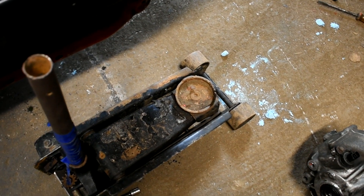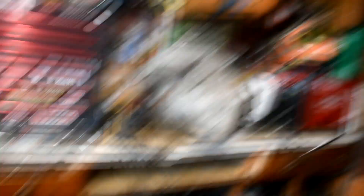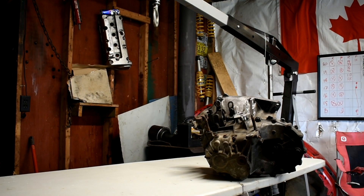Trans is out. I just put a jack under there with a bunch of blocks of wood — big ass trunks of hardwood — so I didn't drop the trans doing it by myself. Pretty simple though: let all the bolts go, get the jack under the engine, jack it up a little, shake the trans to split it. Split pretty easy because it wasn't on there that long. Then just lower the jack, get some wood under the engine, and rip her out. I have a big table in here now and I'm gonna get both transmissions up on the table and start pulling them apart.